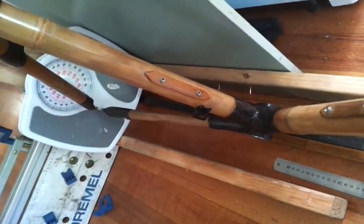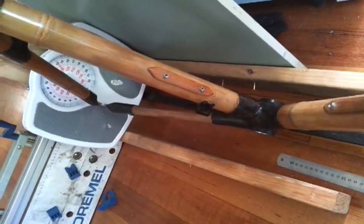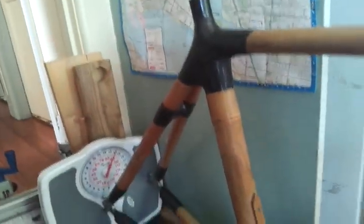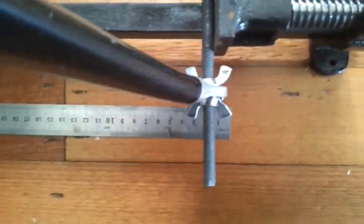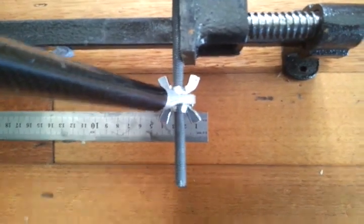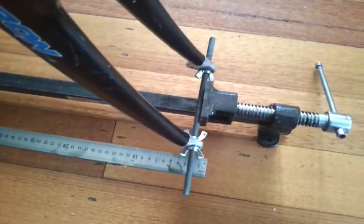So let's go all the way up to 90. So now it's at 90. You can see most of the weight has been taken by the fork here, but it's also being put through the frame. Looking directly above it, that's very close to 2cm of deflection. So let's see what that equals in work — I'll be back with some calculations.